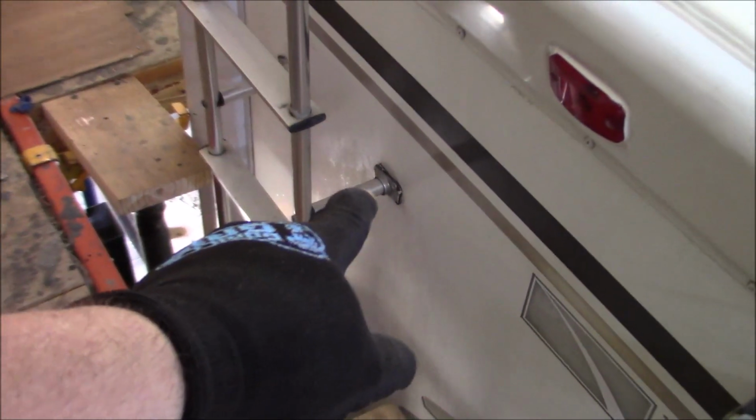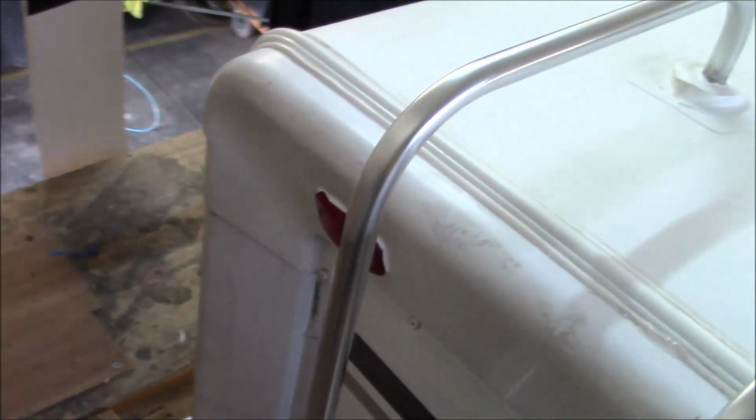We also went around the lights right here. We went around the lights, but I do recommend to go around and seal everything, like on this ladder. Got to clean that out, seal that. And when you seal that, what you want to seal is right in there as well. We're going to double check on those rivets now that I already looked at that. But that's stuff you want to have sealed. You want to have everything sealed up, like even around the windows. There's a light up there. Anything where water would hit, you want to have it sealed.